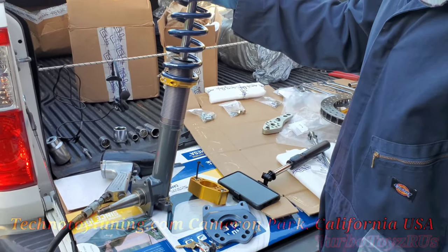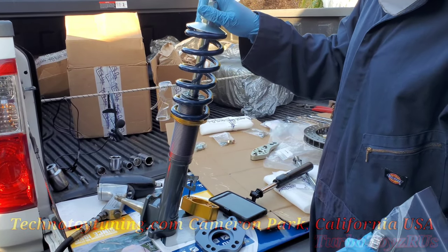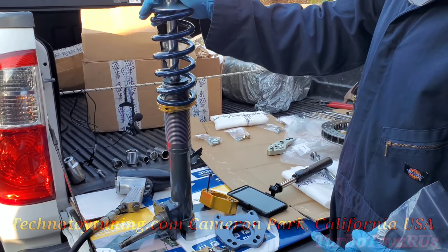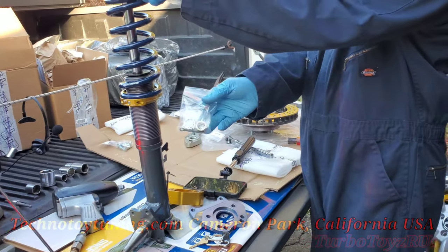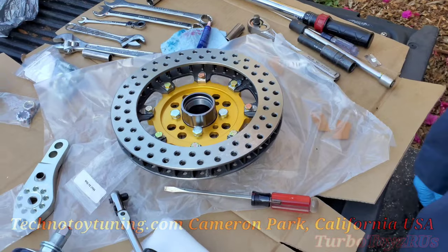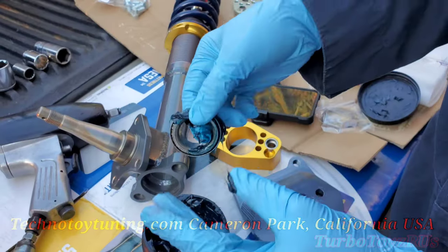Front coilover for the AE86. My car had an RA64 Celica setup on it, so I'm switching it back to AE86 to go with the smooth brake kit. I also got a very important spindle nut and this castle hat. Next up, gonna install these bearings.